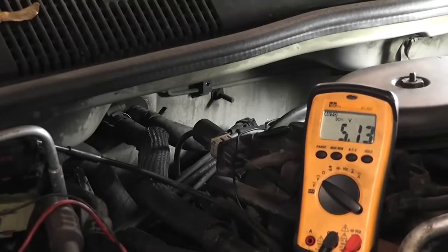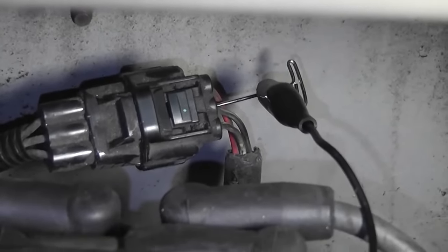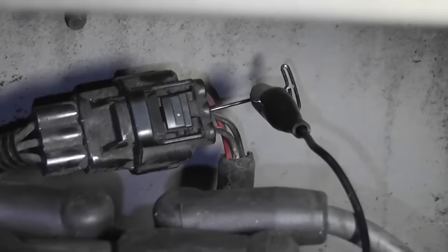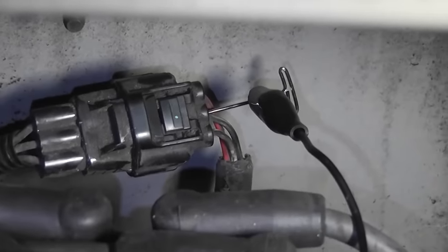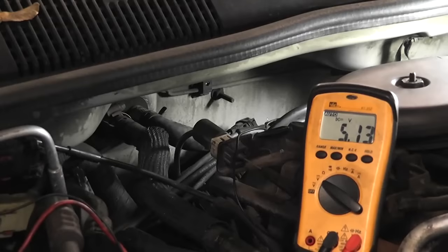What I want to show today is how to do a crank sensor test. I have my voltmeter positive lead going to each of these hall effect wires individually, and the voltmeter negative lead is connected to battery negative for all of these tests. On this particular design, the power feed is the five volt reference circuit, which is also the feed for all the other sensors. So this is a shared reference, shared power feed for this crank sensor — that's what we're looking at first.